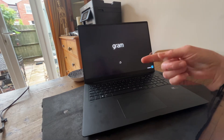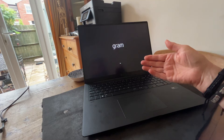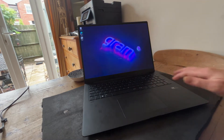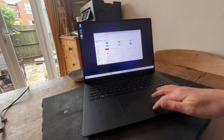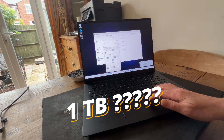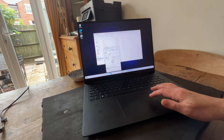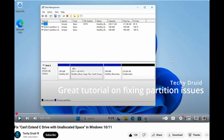What should happen is, now the data has been cloned, it should default automatically to the SSD that's left. Yay — and it works! I'm going to look into Windows Explorer at the C drive properties. Oh — one terabyte. It's showing one terabyte and it should be four terabytes. This is down to a partition issue, and that is a whole different subject in itself. I'll put a link below so you can fix it that way.